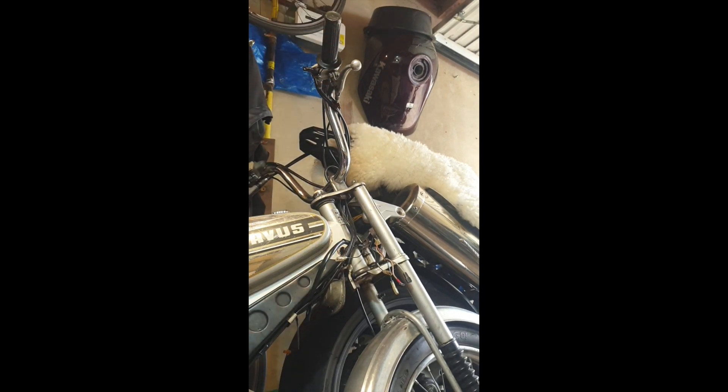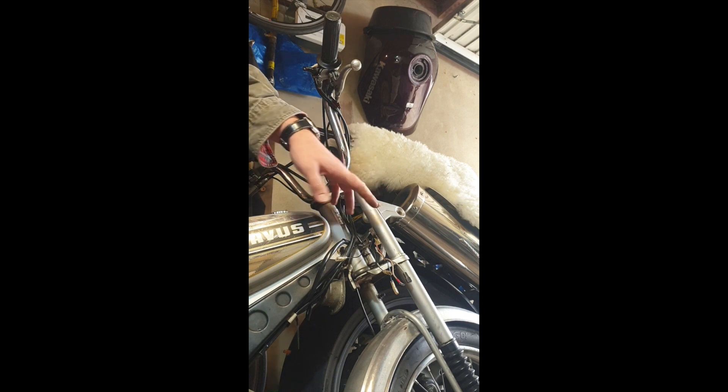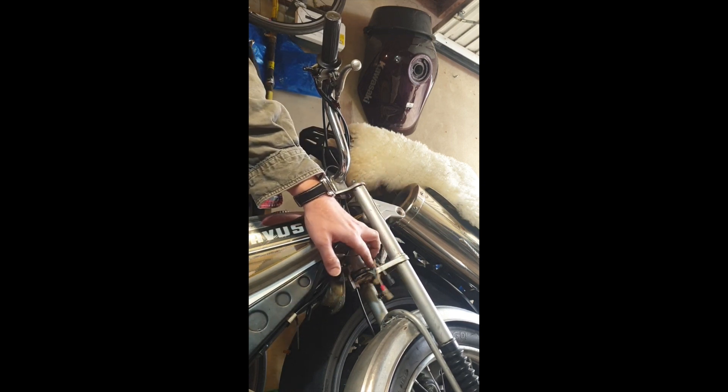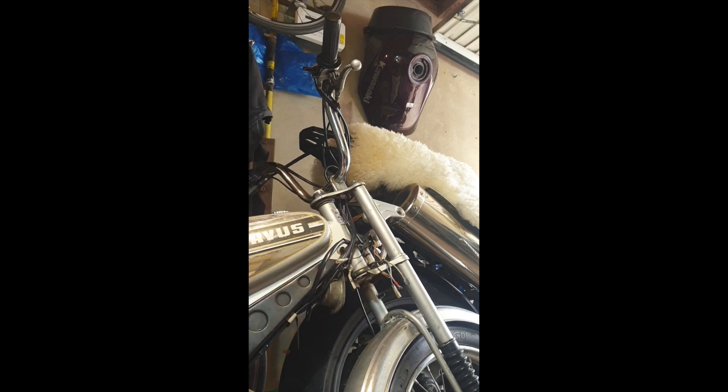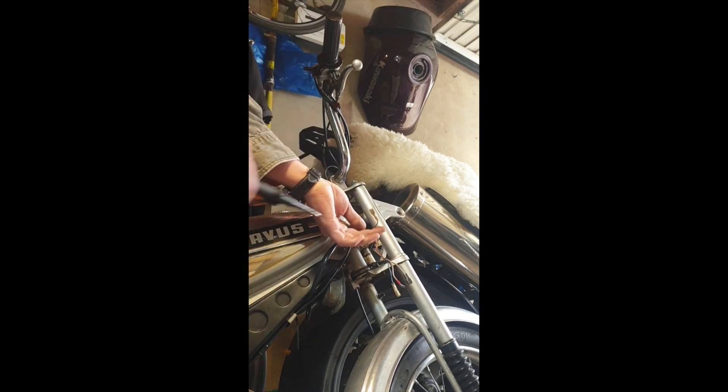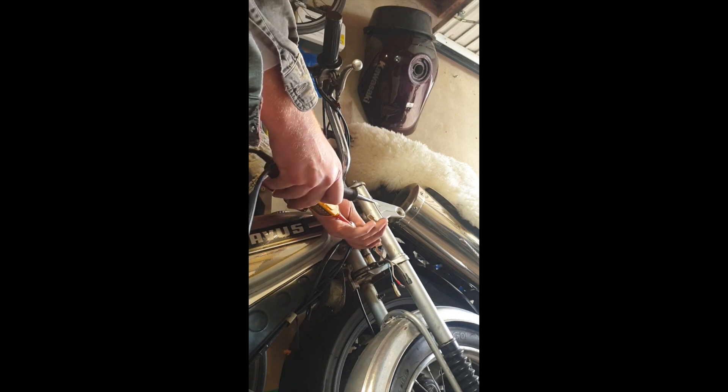My first thought with this - I did start stripping down already when it died. I've taken the headlight off just trying to get at all the electrics, because they're all stuck in the headlight. I've got the ignition coil off, it's on the bench, so I might test that in a minute. But my first thought was maybe it's this switch - there's an on-off switch here that just grounds out the coil. Just going to test if that's working, and if it is we can move on from there.